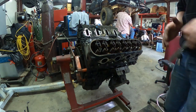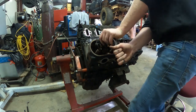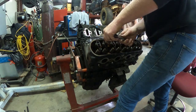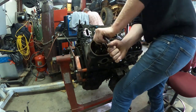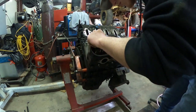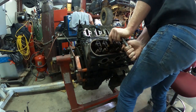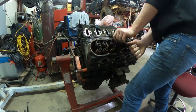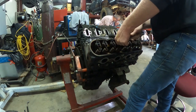Right, so after you take your valve covers off, this is what you see. You're looking at the rocker arms, which is what I'm taking loose right now, and your valve springs. These are an 8 millimeter socket, and be sure to use a 6 point, because that first one there that I worked with, I almost stripped it out, but I quickly went over there and got me a 6 point 8 millimeter and it came right off. These are a little hard to take off because they were torqued down pretty tight, but just make sure you hold your stand down and take them loose.